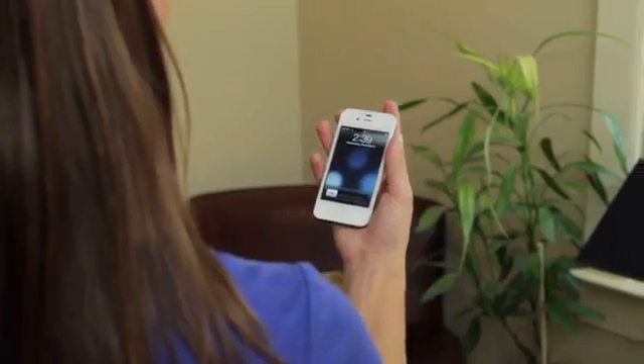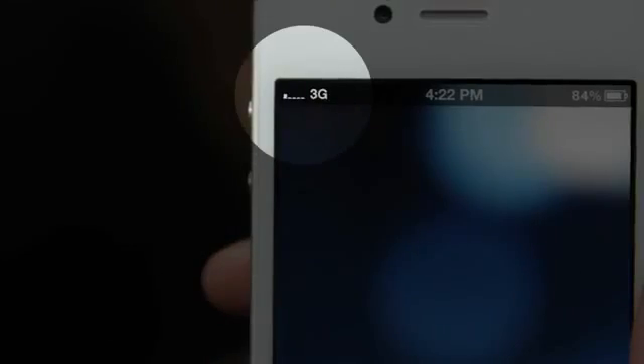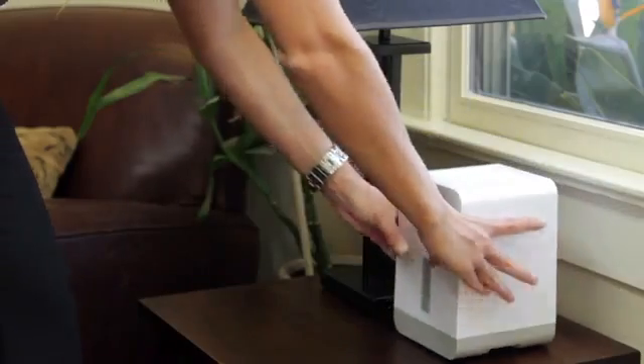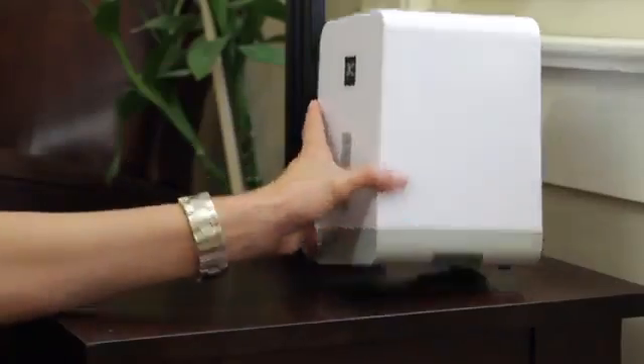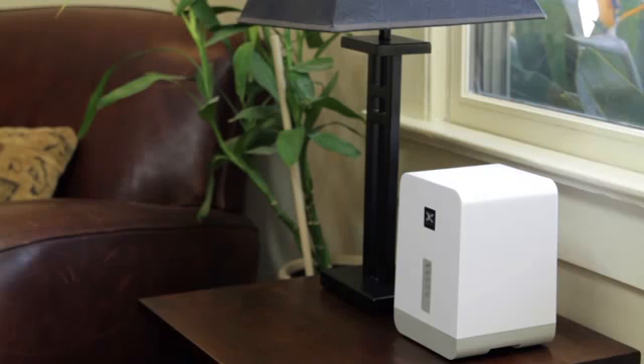Use your mobile phone to find the place with the highest bars in your home. Make sure you see the 3G icon on the handset, then place it in the area where you found the most 3G bars available. Plug the power adapter into the window unit and into a convenient power outlet — it doesn't matter which adapter you use. Make sure the window unit is upright and the display is facing towards the inside of the room.